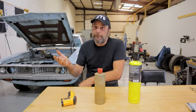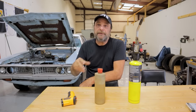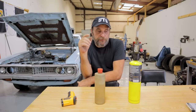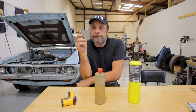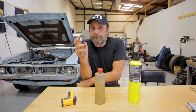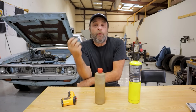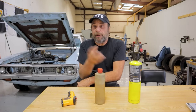It's typical for an engine that's cold that when you flat punch it, it'll just stall, regardless of how big an accelerator pump you have in it. As the engine warms up, now it'll take that gas and it'll run. So the 212 degrees is a good ballpark figure as to when the gasoline is going to boil or vaporize and create some vapor for the spark plug to light.